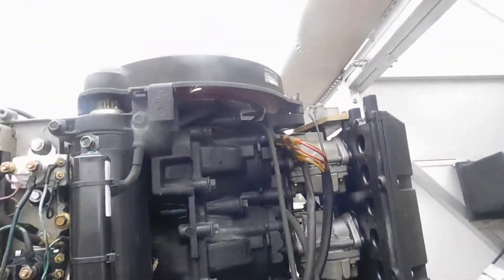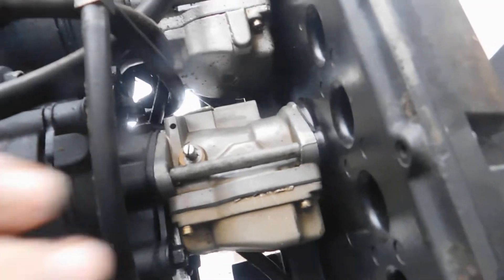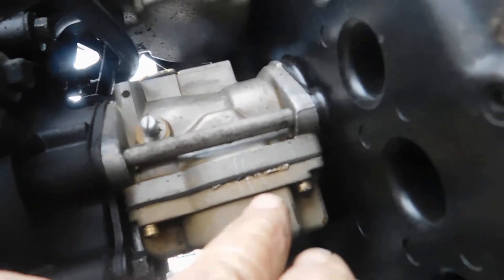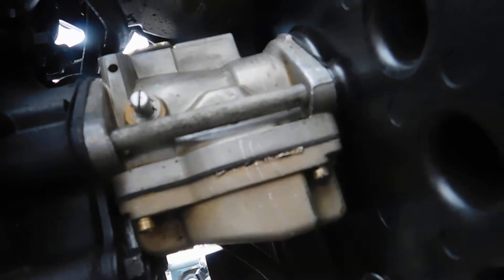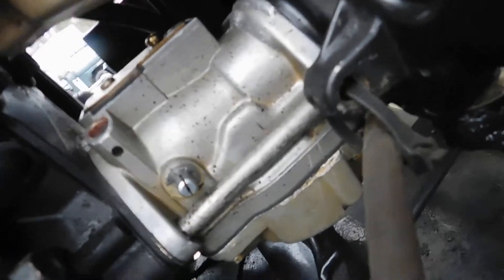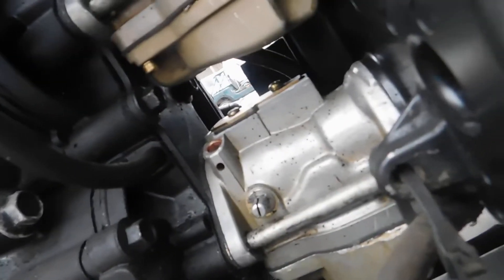This is the motor that came in. The carbs were supposed to be just rebuilt. You can see where that's number three carburetor and where they scraped through there before they took it off to show it was number three. You could see where they scraped through the gasket and they never replaced the gasket. Same with that — scraped four times down there and scraped through the gasket, so they didn't put new gaskets on.